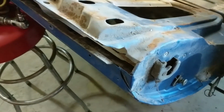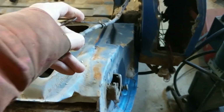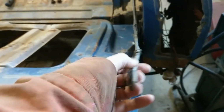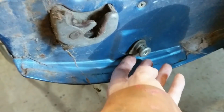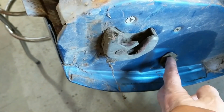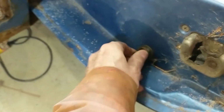Okay, I've got 2 of each side nuts off the hinges on the inside, and then I have these support straps off. They have a little guide on them to keep the strap straight, sort of like an anti-snarl thing. Anyway, they're there. So I just put the bolts back in the tailgate for now. There's a washer, and there's like an indexing metal piece that goes into a little hole. Same on both sides. They come off very easy, no big deal. So I put the bolts back in.